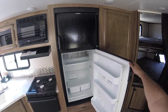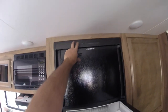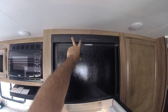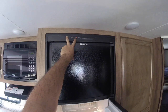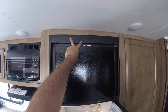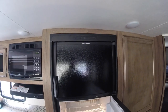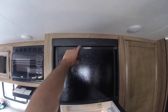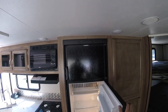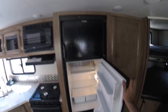You can adjust the temperature on the fridge here for colder or warmer. The on/off is up here — you have on and auto. Auto will automatically go to electrical power first; if it doesn't find that source, it'll switch over to gas. If you don't have electrical power and want to use strictly gas, you can push the gas button and the fridge will light on the outside to gas. If it's on auto and you have a power outage, it'll switch to gas automatically, and when power comes back on, it'll kick back to electric — so you don't have to worry about losing your food.